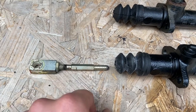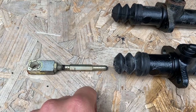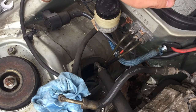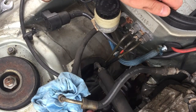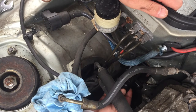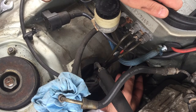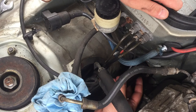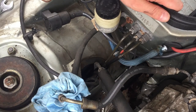So I'm really looking forward to putting that bit back in. The master cylinder will slide into the bulkhead — you can only just about see this on the camera. So I'm going to locate it on its studs that come off the bulkhead, but I'm not going to attach it yet because I need a little bit of free space on the inside to get it onto the clutch pedal, and then I can start bolting it all back together.